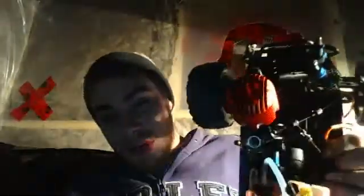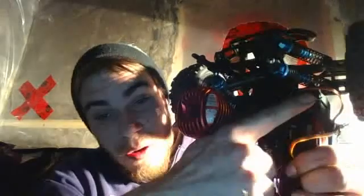that I did using the brakes. So this is the brake. The lever here for the brake, as you can see, for the throttle is very long. That was connected to the brake. So I just switched that around because this is a slide carb, this model, and my other one was a twist carb. So I had to take this rod and I threaded it into the carb piece here.